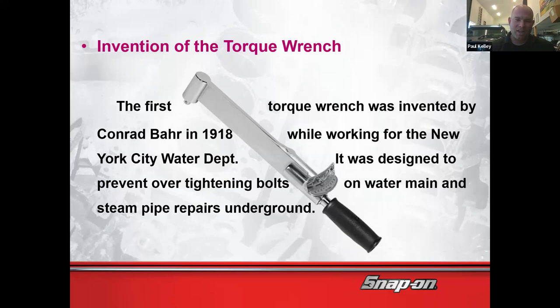So let's just say we take, well, me, I'm old, I'm shot, I'm worn out. You send me down in that sewer hole and I try to loosen those bolts. I can't do it. I'm going to be so mad at Edward. Like, Edward, you over tighten these bolts. What the heck? But is it really Edward's fault? We told him to tighten them. We didn't really give him a number. We didn't say, Edward, tighten them to 76 foot-pounds. We just said, tighten them, right?